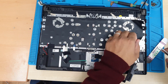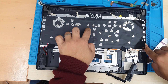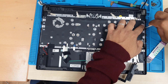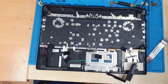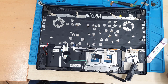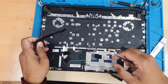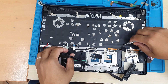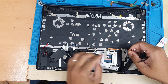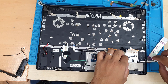Now the terrible part: we're going to remove all the plastic rivets. Let me show you what plastic rivets are — those are kind of permanent soldering which keeps the metal frame and the actual keyboard in place and keeps the alignment correct. Those are very painful to remove. I had to use a small carving knife to cut all of them. Be careful when you do that — make sure you take precautions, otherwise you could damage your fingers or create potential hazards. Do it at your own risk. If you have safety gloves and goggles, that would protect you a lot.